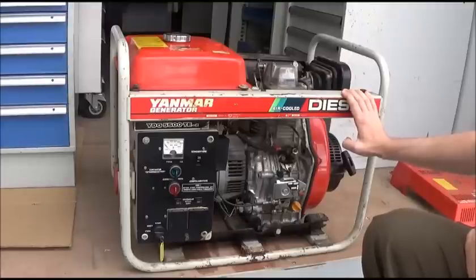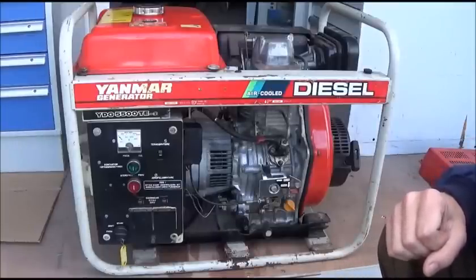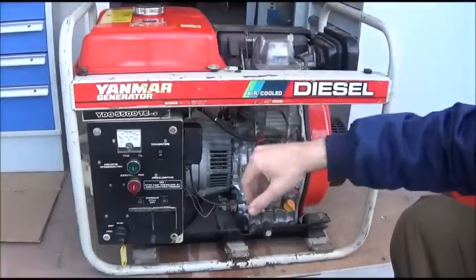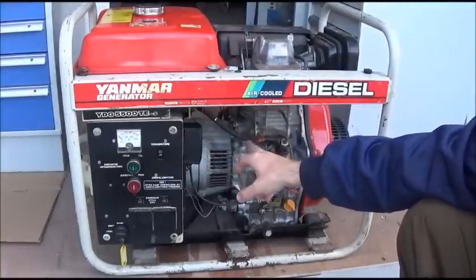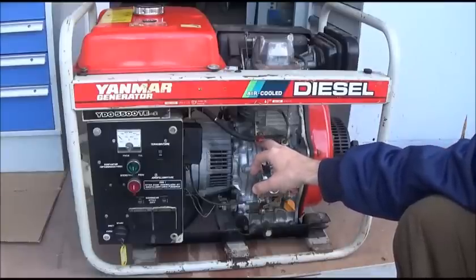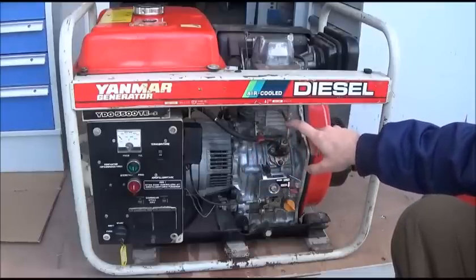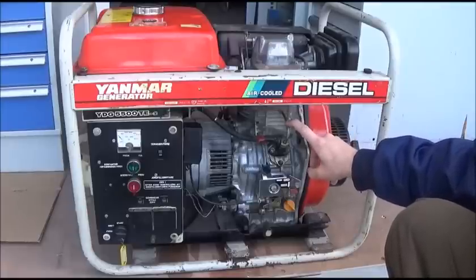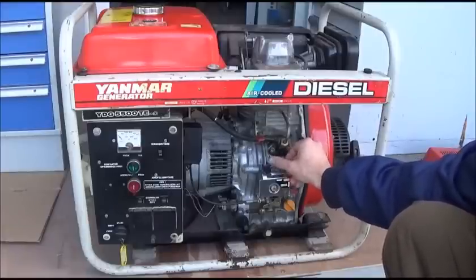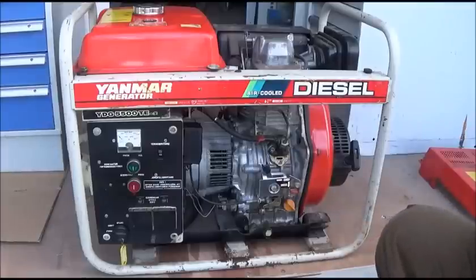This indicates a problem with the fuel, so we're going to have a closer look at the fuel pump. These engines are very reliable, however there is one problem that generally makes them stop operating: when the fuel has been standing for a while and the engine hasn't been in operation, the fuel sitting inside the fuel pump causes it to freeze up. Inside you have a plunger, and acting on the plunger is a cup riding on a cam inside the engine. When the cam compresses the plunger all the way to the top, it can freeze in that position. When this happens, no matter how often you pull on that cord, nothing will happen. Removing the nut at the bottom gives us access to a small trap door so we can see if we have a frozen plunger.